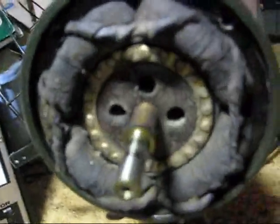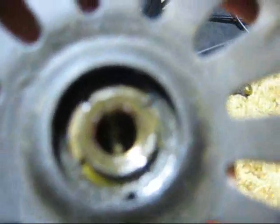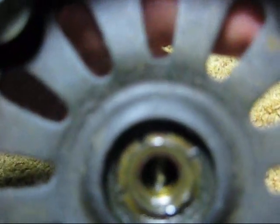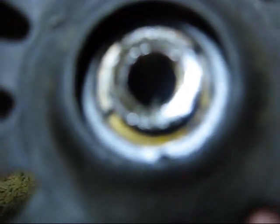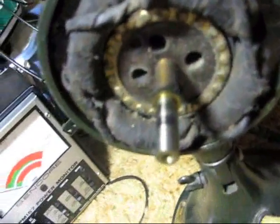A little bit dusty. I have been using it. You see the bearing here is awful oily. That's how it should be. The drain hole there is clear. And what happens is the oil, when it comes in the bearing there through the wick, which you can see in the middle, it's popped up. And note, you should be very careful to take the oil wick out before you put this rotor here back in through to the front.